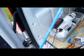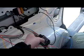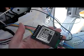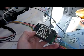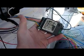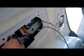When I came in through that grommet I used these nice little things that you can thread together for fishing wire. I fished up inside this box section and here is my wire coming from my trailer socket. Every bypass relay is going to be different, but my particular relay just happened to need the seven colors for the towbar connection.